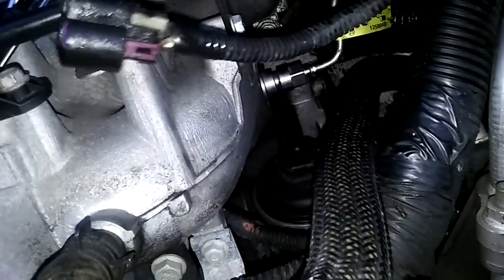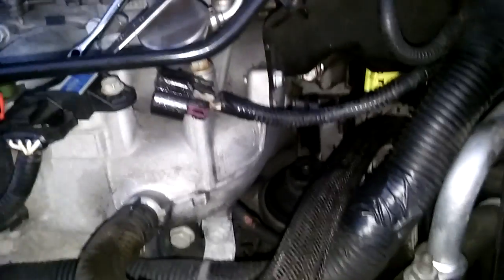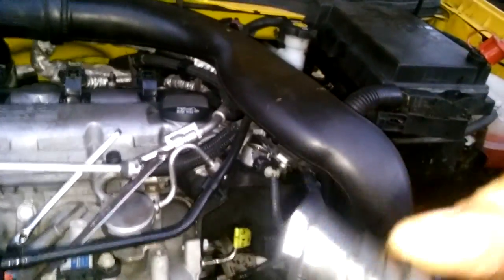There's the old one, and the new one — got it online. It was like $15 with shipping. It doesn't have a lot of oil, so you're probably gonna want to coat the O-ring a little bit before you put it in. If you don't have oil readily available, it's a trick we use in the junkyards — grab it from the dipstick and just wipe it on the O-ring. I took the end of the dipstick and wiped it on the sensor. And that's it.